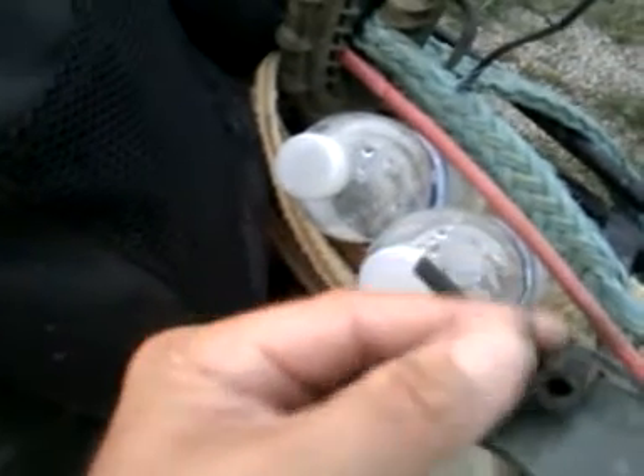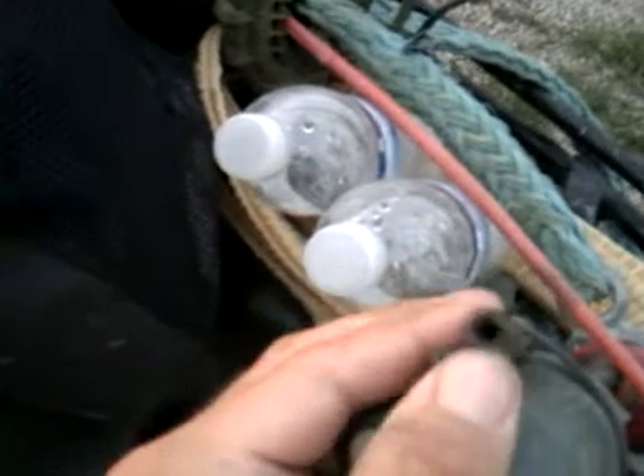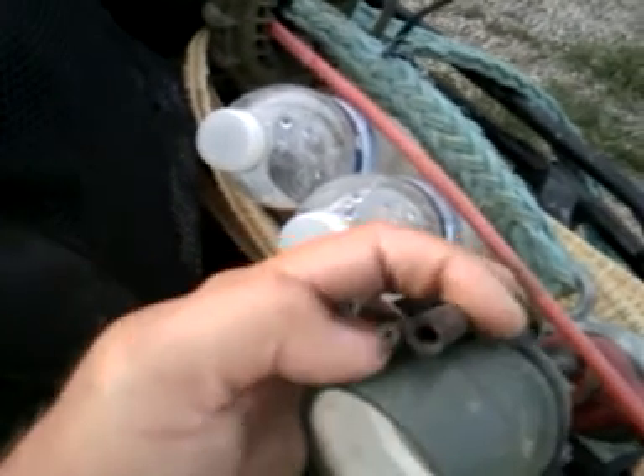You also have to extend your vent lines. This one is for your differential and this one is for your brakes. This one's off the bottom of the gas tank — I think it's a fuel drain, but I extended it just in case. You can pick up these hoses at AutoZone or any auto parts store for about a dollar a foot. If you're four-wheel drive, you'll have one more coming from your front differential. And if you really want to go very deep, you'll also have to extend your gas tank breather — I don't need to since I pull out before it gets that deep.